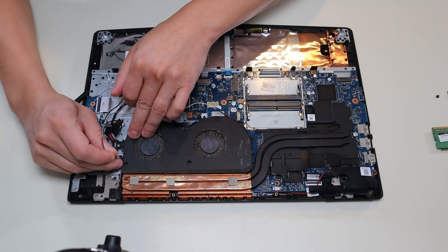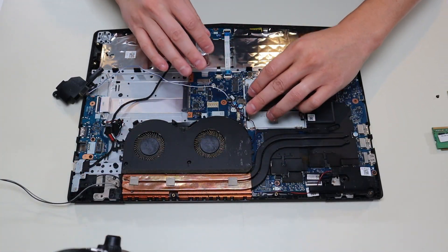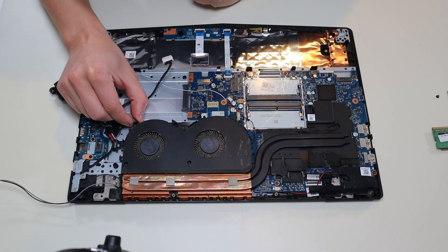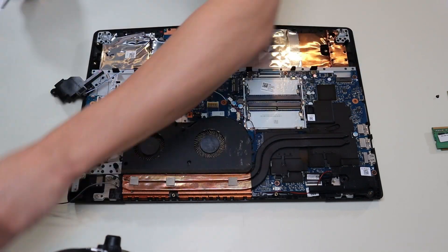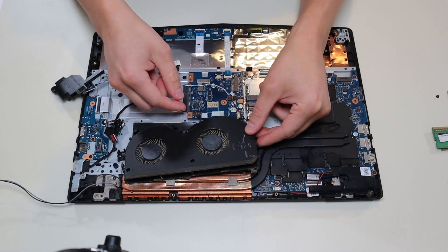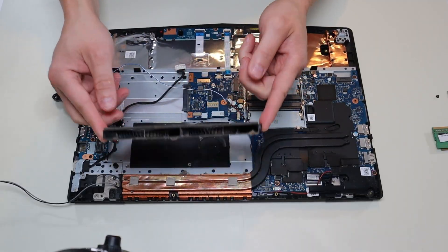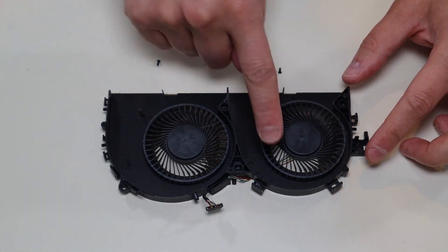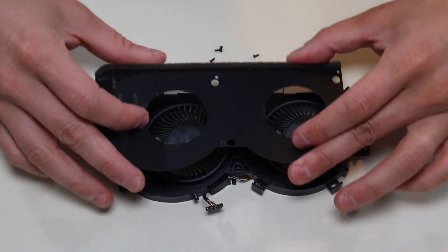Get these wires out from here — the antenna wires, the speaker. For the screws on the fan, looks like we have a screw there and there. So we'll take out those screws and see if we can get our fan up. Both fans have a single plug that plugs into the motherboard, and it's got two grips on either side so I don't have to pull on wires — I can use my fingernails. Yes, that came right up. You can take your fan assembly, take out the screws on the edge, remove the panel, and really get in there and clean out your fan assembly with a vacuum or a blower, an old toothbrush to clean inside the spokes, then put the panel back on and screw it back in place.